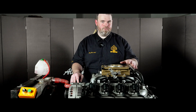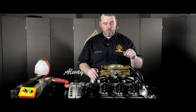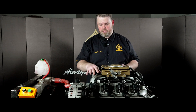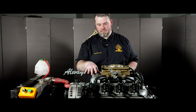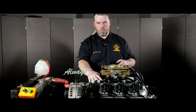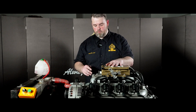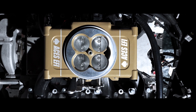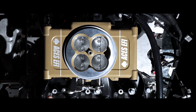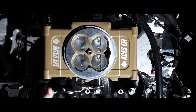Welcome back to the tech studio. We're at our 24x1 LS engine and we're doing the throttle body. We've got a 4150 single-plane cathedral port intake already bolted down to 89 inch-pounds, and we put our 4150 throttle body on top of it. We're running a return-style fuel system — in one side, out the other, back to the regulator, returning to the fuel cell.